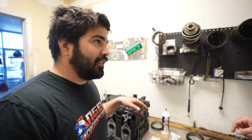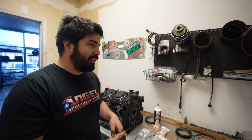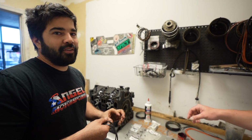Mazda plates are 20-something years old. They're kind of worn out. Yeah, they're fatigued at this point. And some areas are lower than others, so the aftermarket water seals are built to a certain spec. They're slightly oversized to take into account that it is a 30-year-old engine.